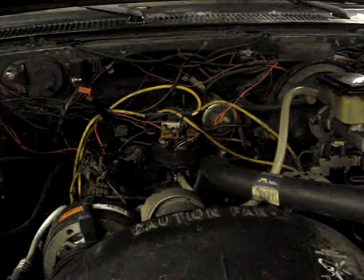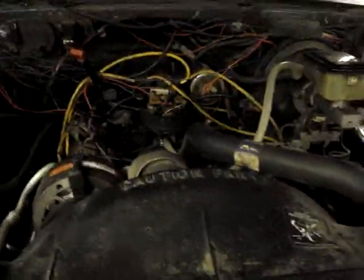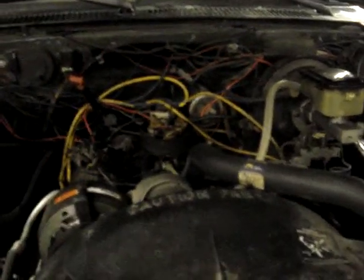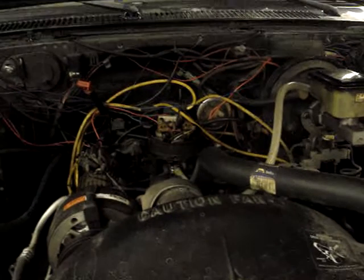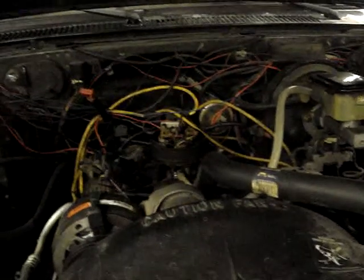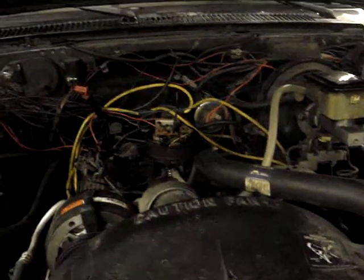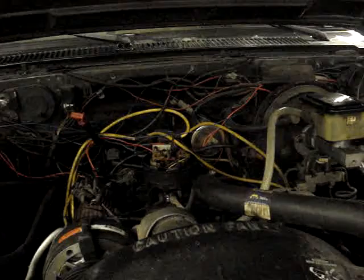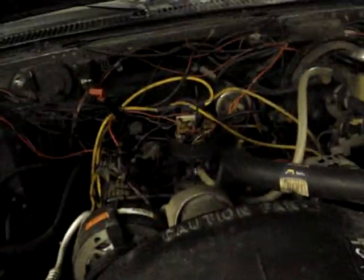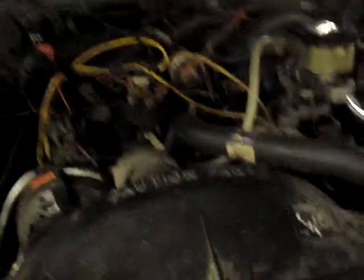I did some mileage numbers last night — I'm pushing 3 liters a minute, pulling my trailer which is very heavy and a big kite. The mileage on this Suburban without HHO is about 14 MPG in mixed driving. Pulling the trailer without HHO is 6.8 miles per gallon, and with HHO it's 8.3 — so it's about a 23% increase. There's a pretty noticeable amount of bottom-end torque. This poor engine's got 200,000 miles on it — it's one of the most inefficient pieces GM ever produced, a throttle body 350.